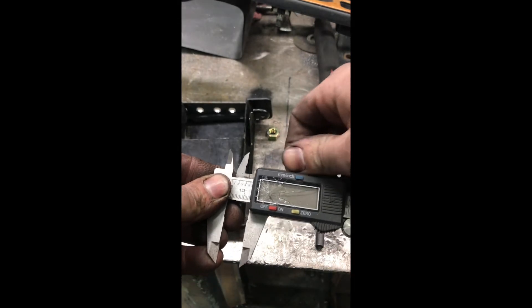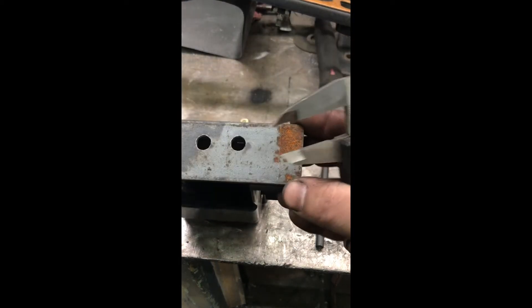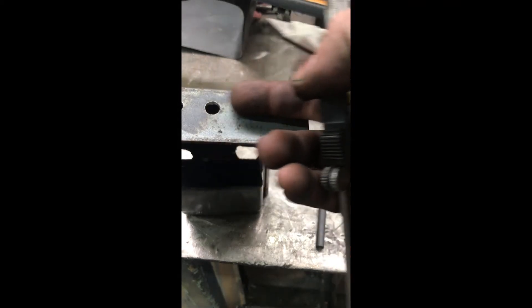Our opening is about 30 millimeters again, so we'll cut that in half down to 15. We'll scribe our line on both sides. Now you can see about where the screw is gonna go. Let's go ahead and center the screws up — same distance as the holes for our control cables. So now we've got our points on both sides.